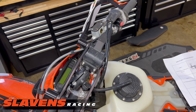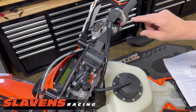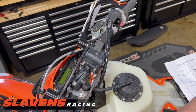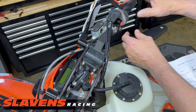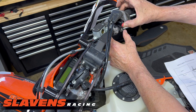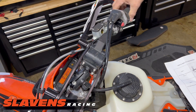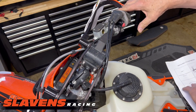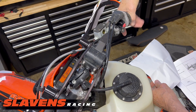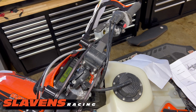All right, we're ready to go. You've got to push both these buttons — focus on this area and this flashing light. The first step: push the kill button, bump the starter button. You see this is flashing. Push the throttle twice, hit the kill button again. It's still flashing — hold the throttle lightly open, hit the kill button again. It's done. That's all there is to it.